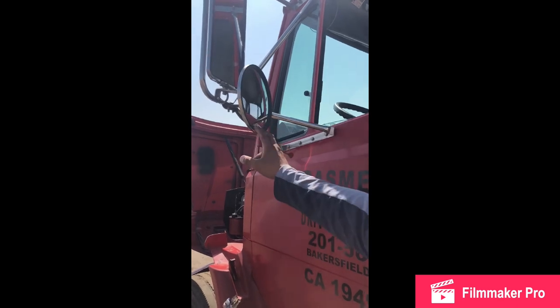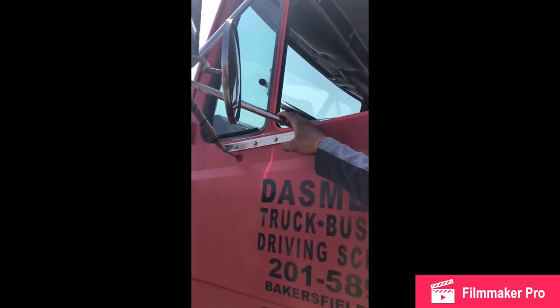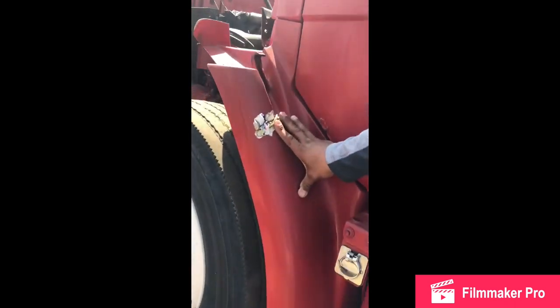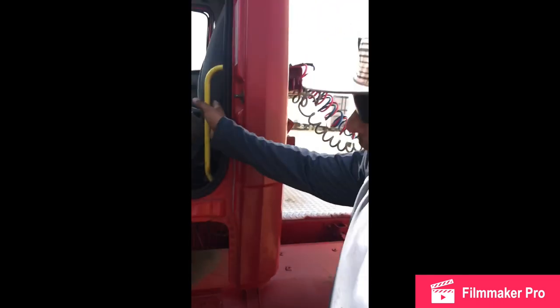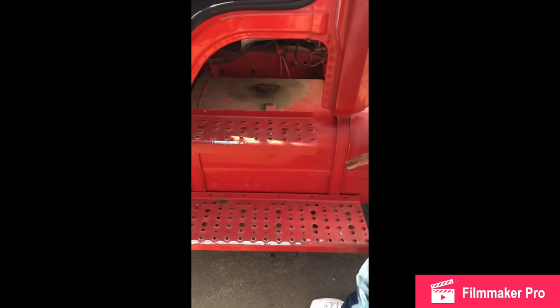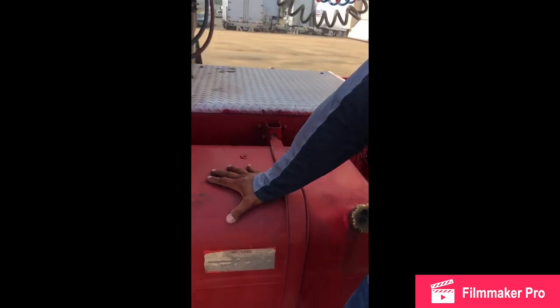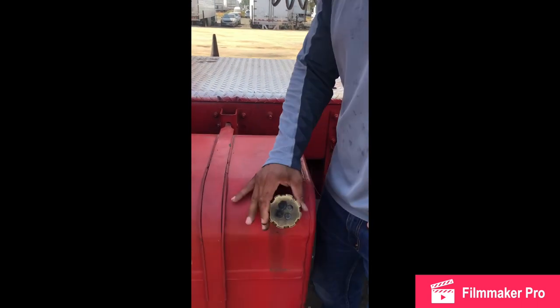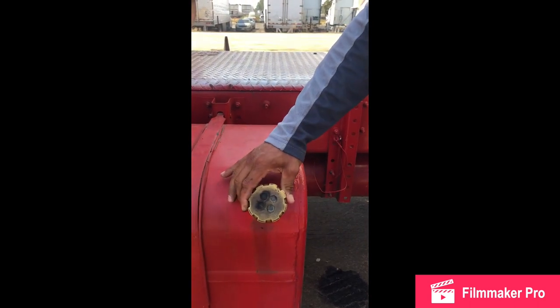My window frames: no cracks, no breaks, no bends, no illegal welds, securely mounted to the cab with nuts and bolts, mounted and secure. My mud guard: no cracks, no breaks, no holes, securely mounted, mounted and secure. My cab steps handle: no cracks, no breaks, no illegal welds, no oil, no grease, always clean, no bends, securely mounted with nuts and bolts, mounted and secure. My gas tank: no cracks, no breaks, no holes, securely mounted with straps, mounted and secure. My gas cap: no cracks, no breaks, no leaks, easy open, easy close, always in a closed position, good rubber seal inside, mounted and secure.